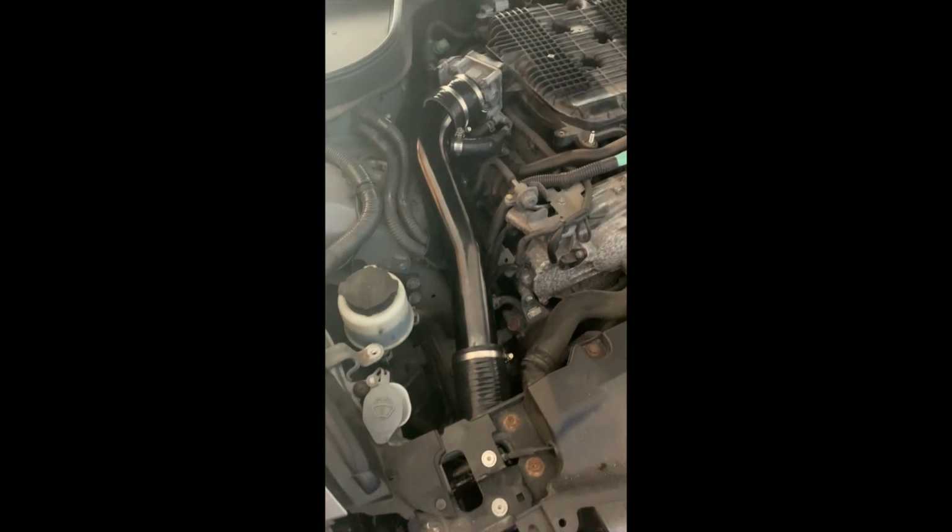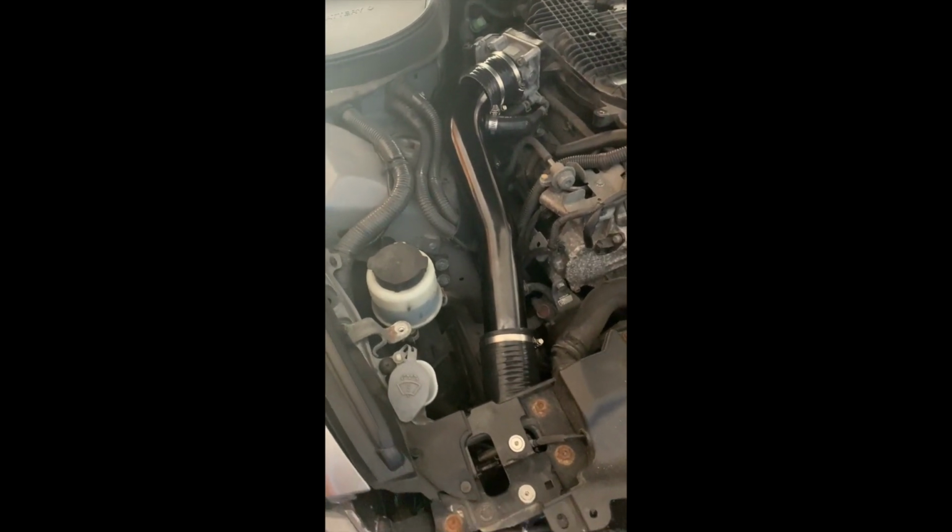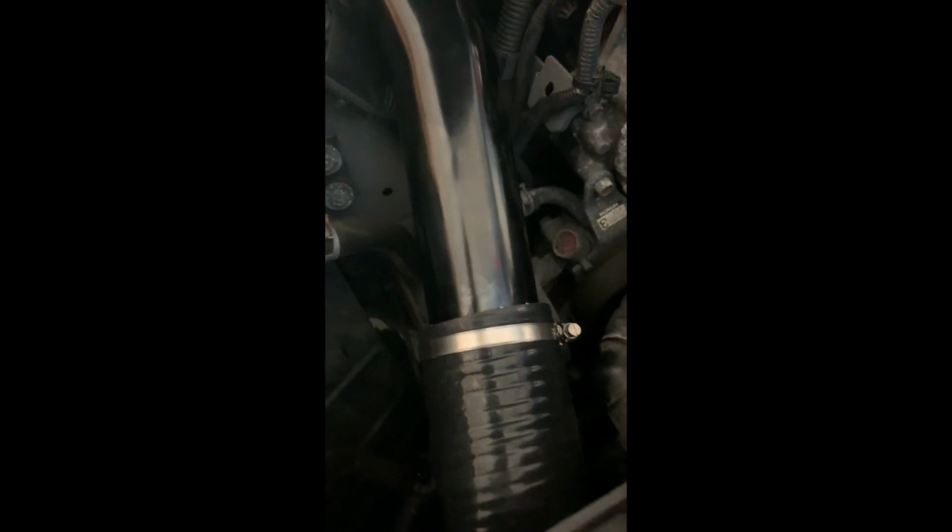All right, next up, let's go ahead and start trimming this guy out with the old Dremel. All right, got the passenger side all in there, so you can see. Took the Dremel, pulled a decent amount of material out of there, as you can see. So just be sure to have safety glasses on. Just use one of these rounded attachments and just worked my way up, but that just frees up some clearance per the Z1 instructions, so you don't have any pinching on here, so you lose potential performance. Then you just really feed that through.